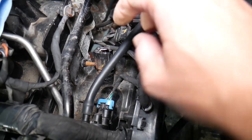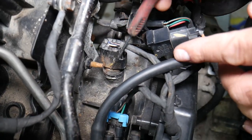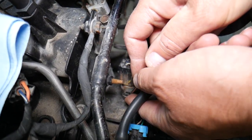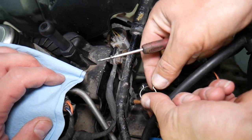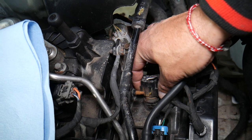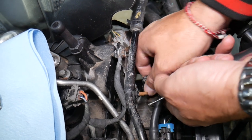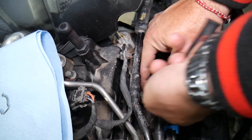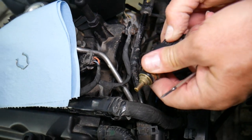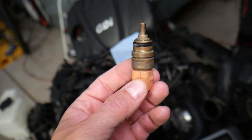To remove the sensor, you'll disconnect it later. There's a spring clip — gently get a screwdriver, lift it up, and pull it down. Make sure you don't have coolant in the system. Now grab the sensor and pull it out — it may be stuck because of an O-ring that prevents coolant from coming out. Just grab it and pull. Press down to release and pull it out. That's the coolant temperature sensor, and that's how you remove it.